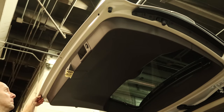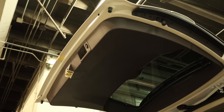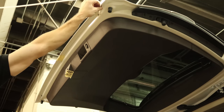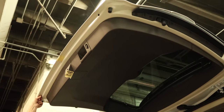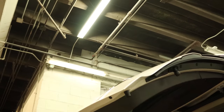Now on to the lift gate — it's got some drain holes in the back. So we'll tape out the center one; the two outer ones have little plastic caps, so we'll pull those off. Put our wand in there and get to the other side. Oops, a little misfire. Clean up our mess and put our caps back in. We'll pull that tape off later after everything gets solid — otherwise we'll have a mess all over the back bumper.